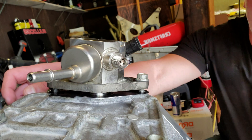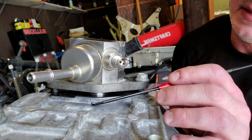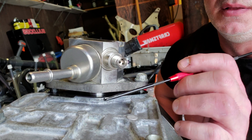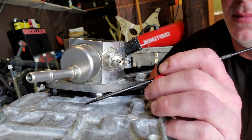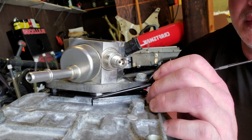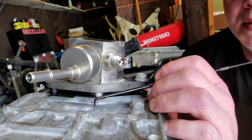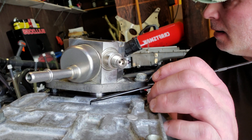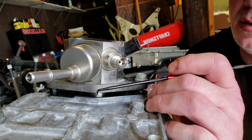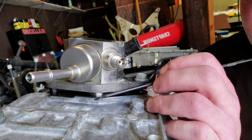In this video we're going to be essentially measuring the lash cap. I did a .060 lash cap on the cam lobe, the high pressure fuel pump lobe lifter. That added .060 thickness to the top of that lifter, and that is because I am using a 32% Vengeance Racing tri-lobe cam. That .060 lash cap is required to set an additional preload on the high pressure fuel pump.